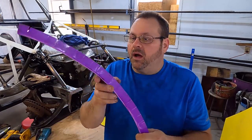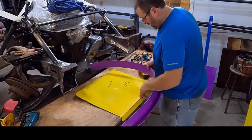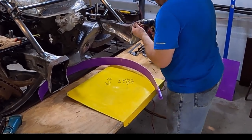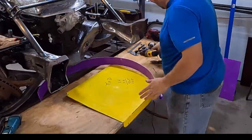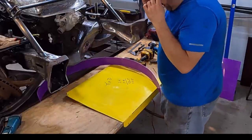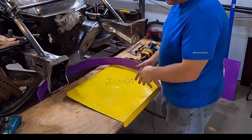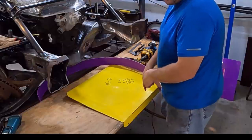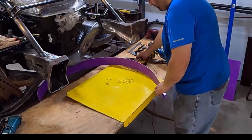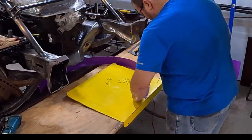This is what I normally do. We've got this line. We're going to put a joint at the bottom. This is super simple. I'm going to rivet it now. It's not a problem for me to have this stand off the radiator like half an inch, so not a problem to have the inside of the rivet there. If there's any concern about the rivets, you probably want to cleco it from this side and then flip it over and put rivets through from the other side. But I want the flush side on the outside to look nicer, and they're not going to create a problem inside.